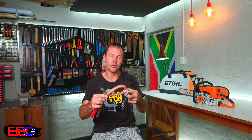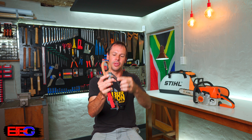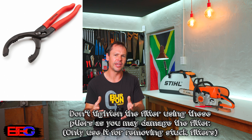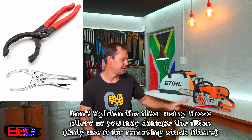Earlier I mentioned other options if you don't have an oil filter socket. You get things known as a strap wrench — your oil filter goes in the gap, you pull it tight and rotate to loosen the filter. Another version uses a chain but the same principle. Honestly, don't waste your money on these — they're absolute rubbish. Instead, get yourself a socket that fits the oil filter for your vehicle, or better yet, get a channel-lock or slip-joint pliers designed for oil filters with long jaws and little grippy bits on the end. Those work pretty well, as does a vise-grip style with long jaws and grippy bits. Don't waste your money on the strap or chain wrenches.